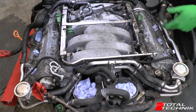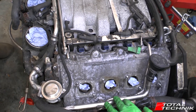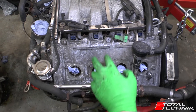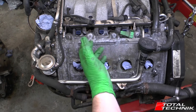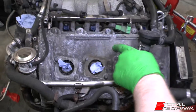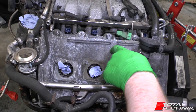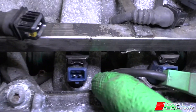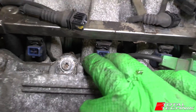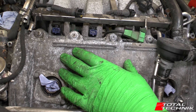On either side — it's a V8 — we've removed the coil packs. This is where the coil packs normally sit, four on each side. Below these, in these little holes, are the spark plugs. These are your rocker covers. They're not too bad on the RS6, but you can sometimes get an oil leak from your rocker cover gaskets — a trickle of oil leaking down the side of the engine. That's quite commonplace on lots of Audi models. The rocker cover gaskets sit under the rocker covers, and there's a piece of rubber sandwiched between the two pieces there — that's the gasket. So if you get an engine oil leak that looks like it's coming from the top side of the engine, check that out first as it's a likely candidate.